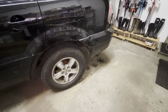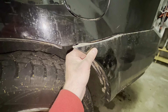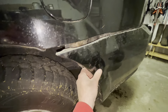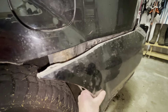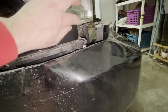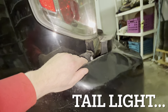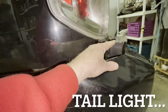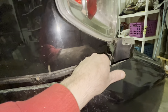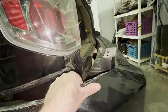Now with all your bolts removed, start inside the wheel well. You want to pull it straight out towards you and go very slowly along the bumper. When you get to the back, don't pull it down. You've got a back headlight right here — you'll be tempted to pull down, but don't. If you look at the tabs, it goes straight in. When you get around the corner of the back of the car, pull it straight back.